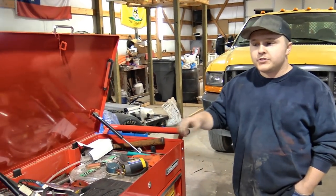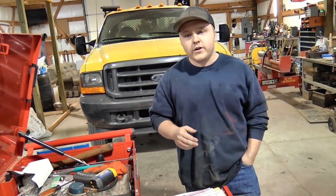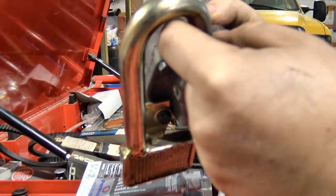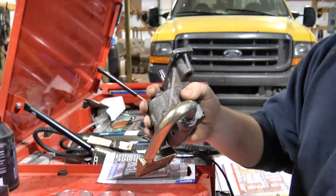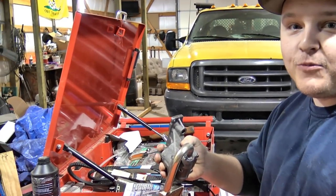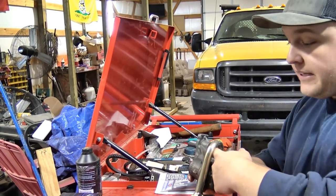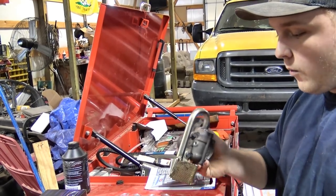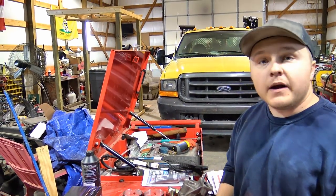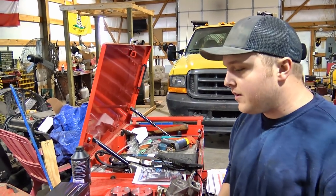So basically what Josh was just describing — we were at the track the other week, testing, and I noticed when I was going through the center of the corner I was losing oil pressure. When I dropped the oil pan, I noticed that my oil pump had basically a hole with no pickup tube — the screen and everything was actually laying in the bottom of my oil pan, which is not good. Lose oil pressure and it could make a big boom going around the racetrack. I took it to my engine builder, he got me a new pickup and screen, and actually used his TIG welder to make sure it's not going to fall off — completely welded all the way around. So just to be safe, we went ahead and pulled one of the main bearings which the crank rides in, and those bearings looked decent — we didn't have really any wear on those.